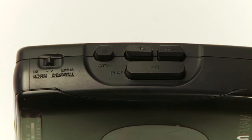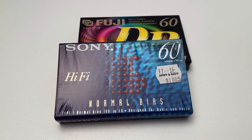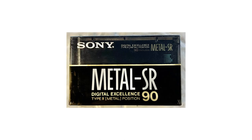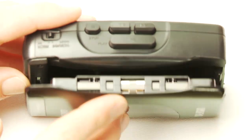With those, you have a dual function switch. DX/local is for FM reception — DX if you want the tuner to be more sensitive, and local if the signals are closer. Norm is for regular cassette tapes known as type 1. CrO2/metal are for type 2 or type 4 cassettes, which are tapes made out of metal. It reduces the hiss by using an equalization filter for each type of tape.